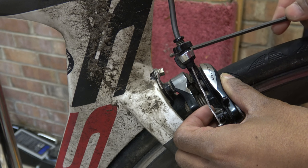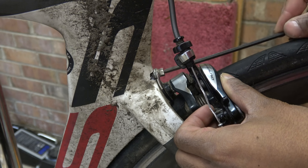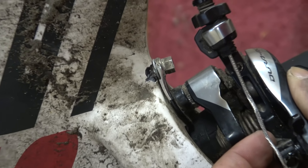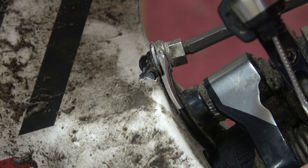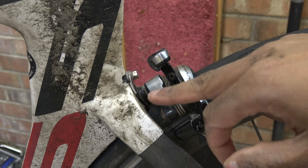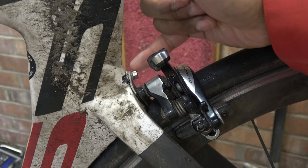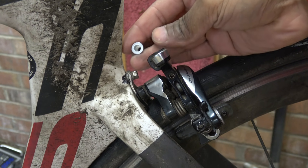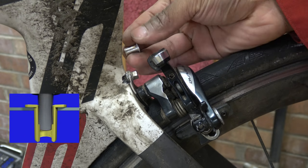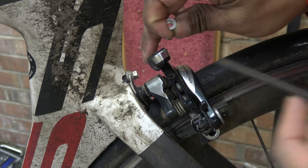What I wanted to do was take the back brake off my bike to clean it, and when I went to put the allen key in and turn it, what's happening is the rivnut — which is this piece in here — is turning with it. If I zoom in a little, hopefully you'll be able to see that. You can see it's also chipped the paint off. So what we need to do is get this out. What you must not do is pull it, because you could break your frame. We need to get the bolt out before we attack the rivnut. The rivnut is in there like that — as we use the correct tool it pushes the back in and then leaves it in the frame. The bit that we can see turning is this bit, and that's the bit behind this bracket here.